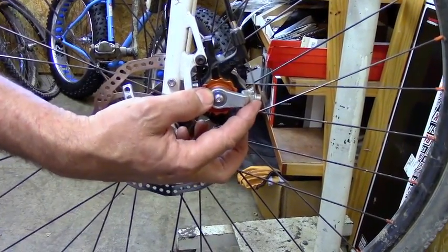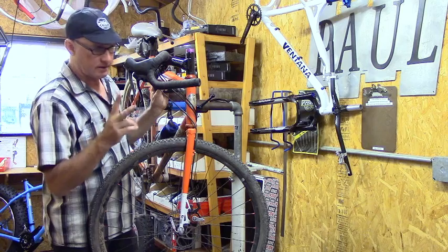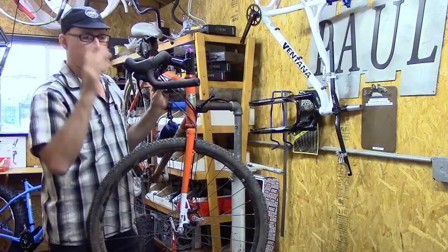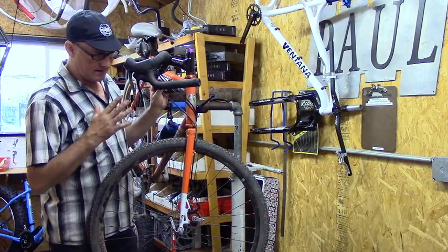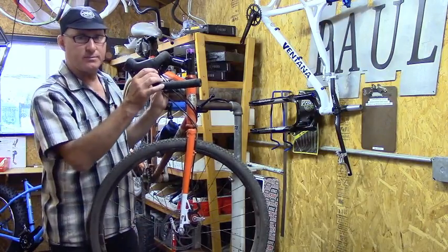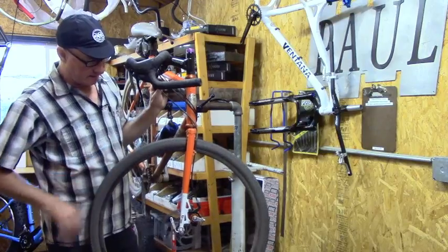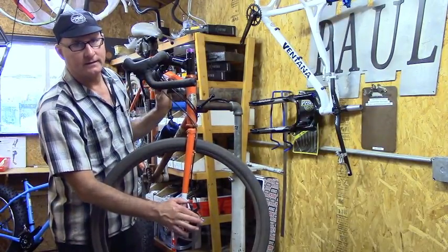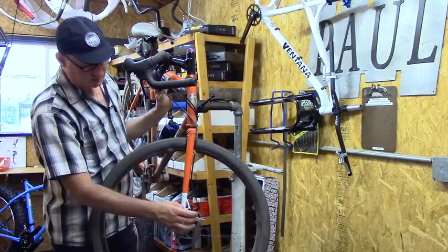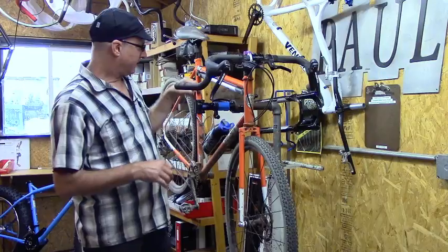This arm length is critical because we want it to work with a short pull lever or a long pull lever — we're going to have two versions. This is a short pull lever, but we want this to have great power and great modulation. We wanted that sweet spot where it doesn't rub the disc all the time, but you still have good power, and when the power comes on it's not just on or off — we like a little ease in and ease out. Turns out this is the final length. This is still a prototype but these parts are getting made now, and hopefully when you're watching this they will be available.